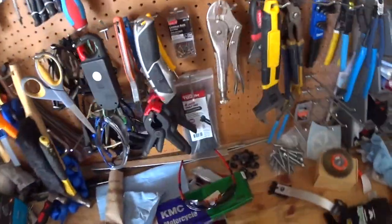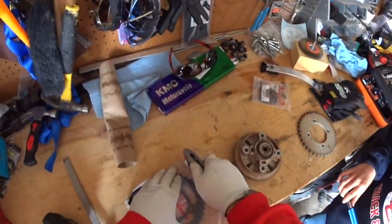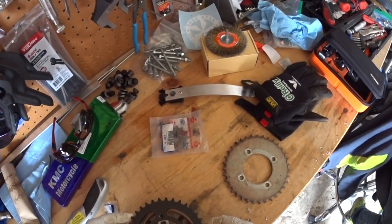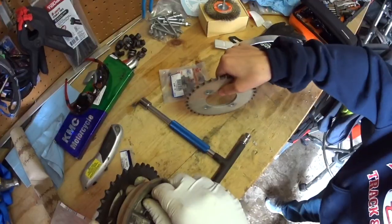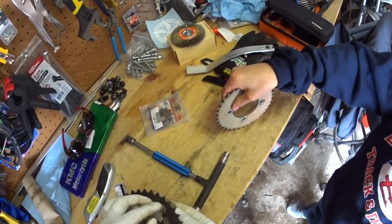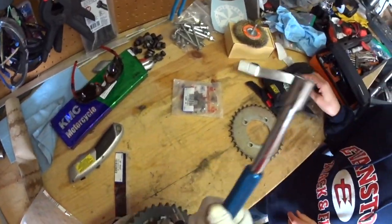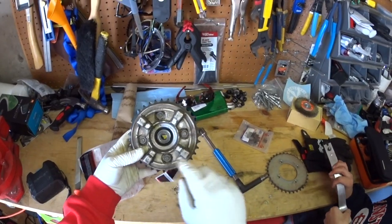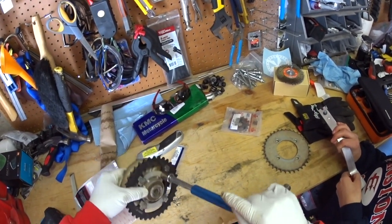We can get our new ones out. So, here's the new one. Here is a brand new, fancy dancy one, and looks like it fits. And we'll go ahead and grab this hardware. So we have to start this on this side like that, and then push it up, and then run it in. There we go. Just want to make sure these bolts aren't sitting up off of there. And then we'll use the good old lug nut stud star pattern and just tighten these up as evenly as possible.